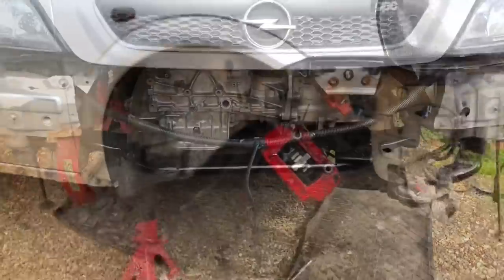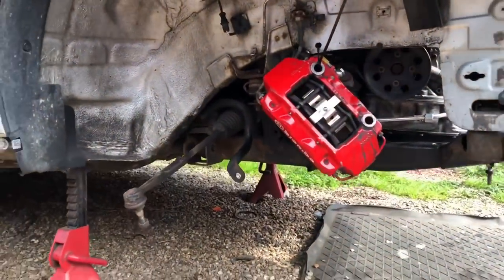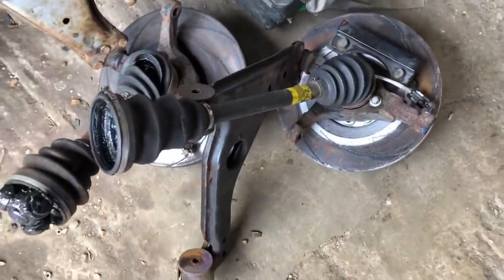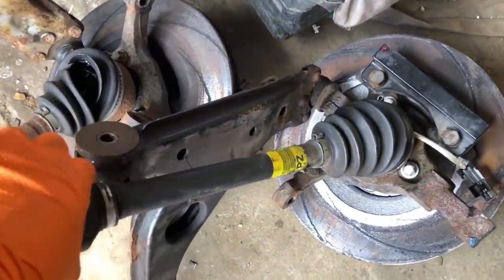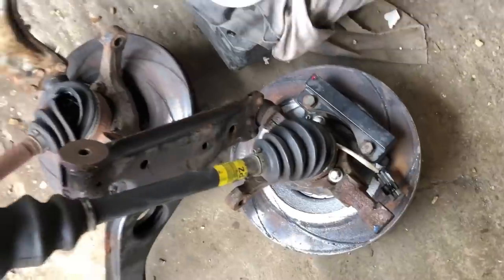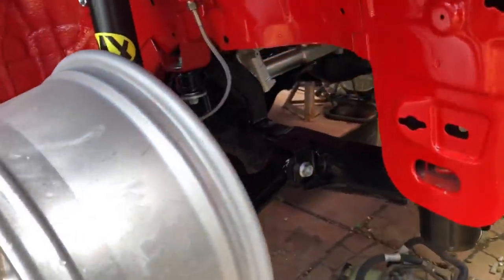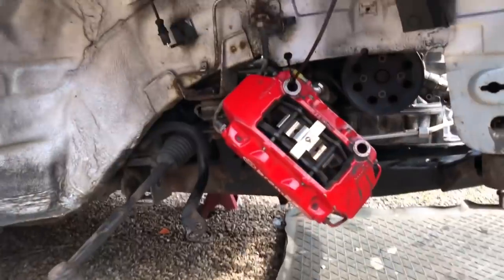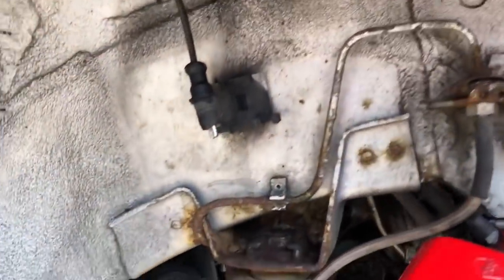It's going to be a lot quicker to do luckily because I've already stripped down all the stuff under the arches, already removed it all. This is all getting rebuilt — all these parts getting rebuilt maybe in a different video. For now we're just going to get the subframe off. All this starts getting replaced, blasting cabinet, blast it all, paint all the stuff. It's only a track car but I want to replace all the suspension parts nice and tight. I'm also going to replace that brake line because it's nasty. I've got this pinch bolt under here — always make sure you do that before you try to drop the subframe down, otherwise you can't unbolt the steering rack.